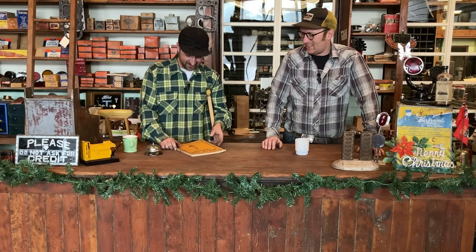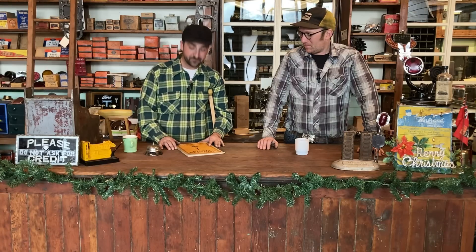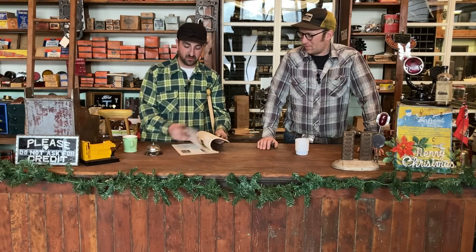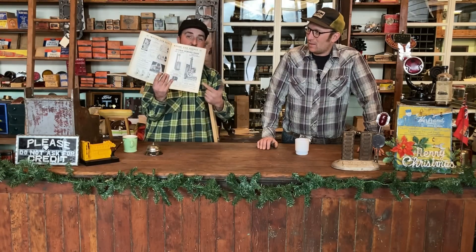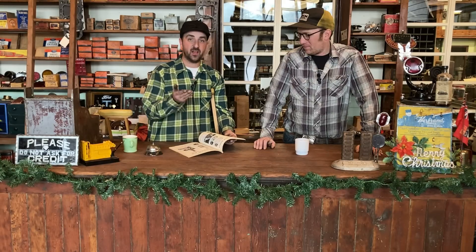We helped him — we put a sleeve in it. Scott has the whole broad spectrum of putting that sleeve in, so we thought we'd just hone in — no pun intended — on some of the tools and trade. The Motor Car Supply Company catalog: they were a tool distributor from Alberta. The catalog's from 1936, and the machine we used is right here — it's the Storm S50 Boring Bar. There it is doing a Model A. And the Stormizing machine — stormize your engine. The cutterhead's patented in the teens.